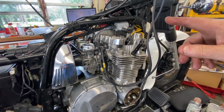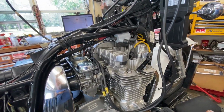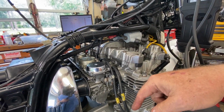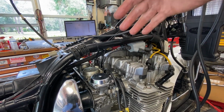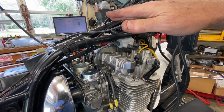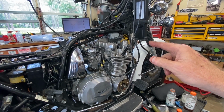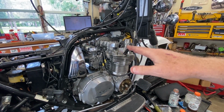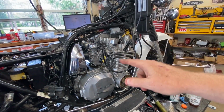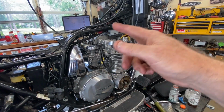And therefore, you're not going to have that inertia. And in idle, you don't have a whole lot of inertia from RPM anyway. And then when she comes around to an intake stroke, because the power stroke has been exhausted or completed on the cylinder previous, it's going to pull a nice fast charge. So in other words, you've got to look at a motor with the idea of it, at an idle, not necessarily being a linear, regular turning of the rotation of the crank.